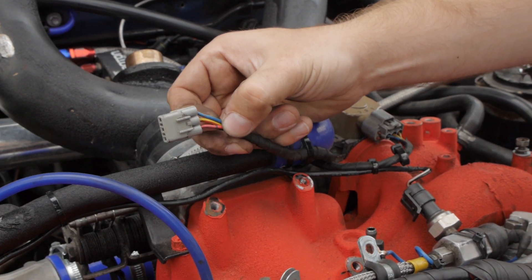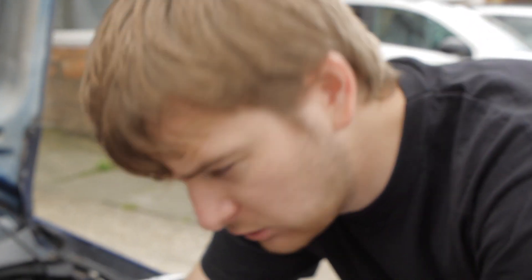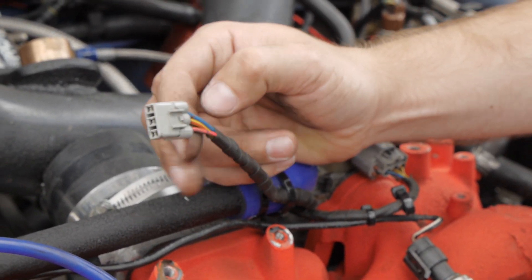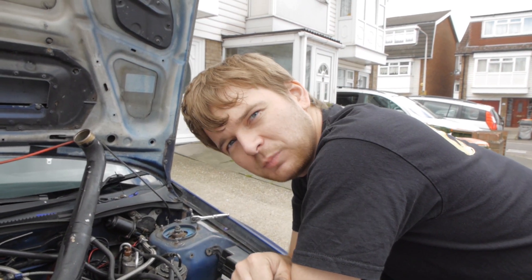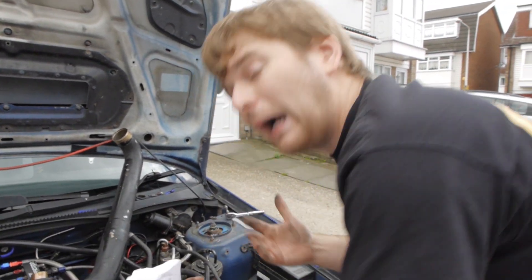You've got three wires here. The yellow is your 12 volts constant — that's your power supply — and the blue and red are your signal wires. This particular model version of the car runs what they call a wasted spark. Which means the two opposite spark plugs always fire together. On newer cars you'll have four signal wires for four spark plugs individually, but this one runs a wasted spark, so every pair of spark plugs fires at the same time.